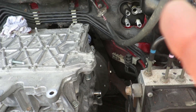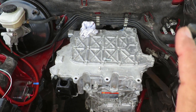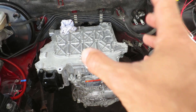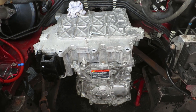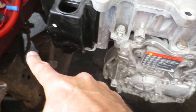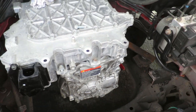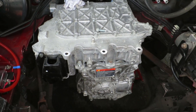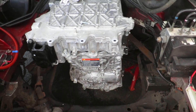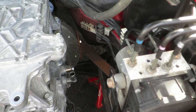The other thing to note is that the power plant frame that mounts onto the gearbox is a fixed structure. So from the back of the car, all the way to the gearbox, all the way to the adapter plates and the motor, it's all one solid unit going right back to the rear axle. It can't really rotate — it's fixed at the rear axle with four high tensile bolts. It can go up and down, bobbing on the engine mounts, but rotationally it's very fixed. Most cars would have engine mounts but wouldn't have the whole drivetrain mounted back to the rear axle like the RX-8 does.